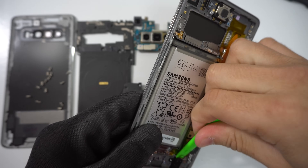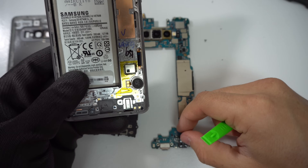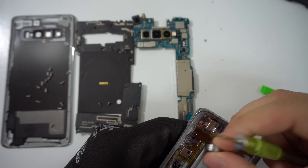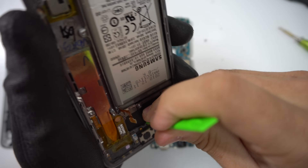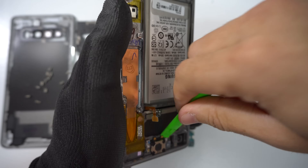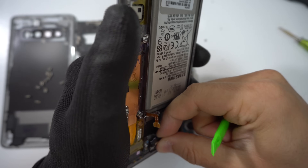Let's go ahead and remove the headphone jack — if you pry it up gently, it will come off pretty easily. Then remove the vibrator motor with a thin solid prying tool — squeeze it in there and it will come out pretty easily as well. Next, we'll also remove the ear speaker by prying it up with the prying tool, wedging it under and gently giving it some pressure upwards until it comes out.